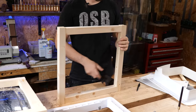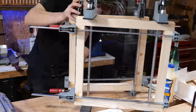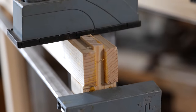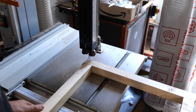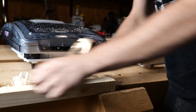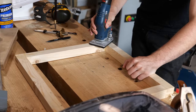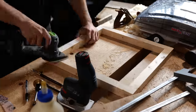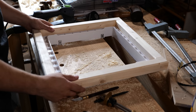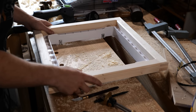When using a bandsaw for this joint you don't need to mark out too much — you can rely on the fence to cut things straight and parallel. Just get a few extra pieces of timber to test the joint while setting up the fence. After cutting, one frame fits together well — a tiny bit of movement, but that's fine to allow for any discrepancies. The second corner has a much better fit.